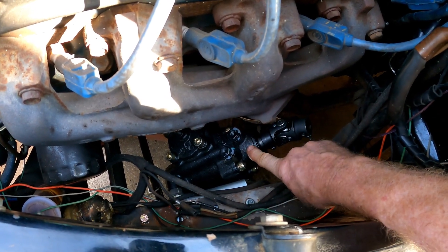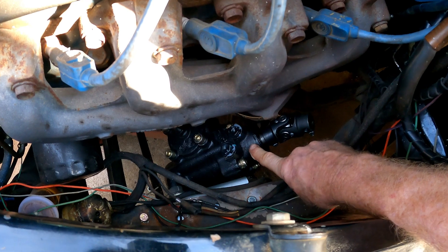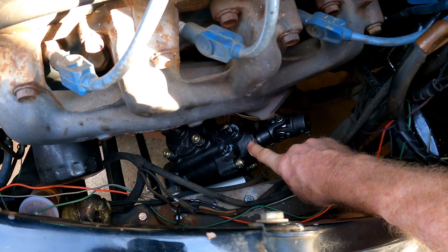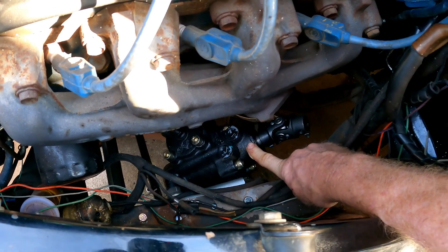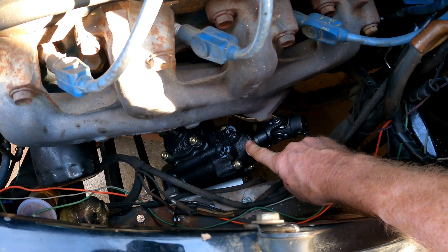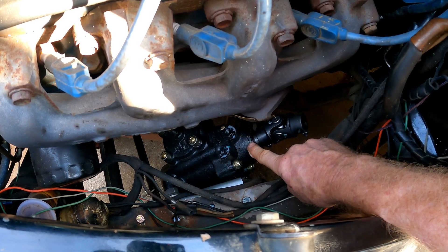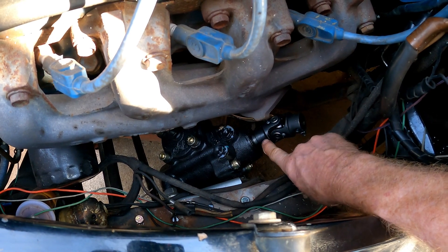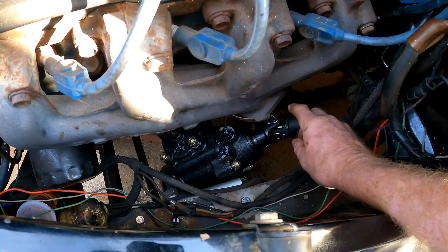Being a Vega box, there's a lot offered for it. I believe it was called a 500 series — it turns out Vega only had manual boxes, so there are companies that build power steering versions of them now. It wasn't too bad — the box is about $400 and you can buy any kind of arm you need for them. The spline count tells you what you need so you can buy the right u-joint.